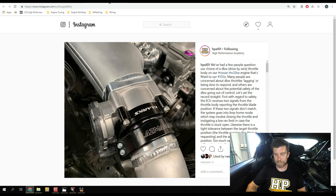If we head across to my laptop screen, this is an Instagram post I put up a few days ago. We did get a few comments on our Facebook page about this. We have gone to a Bosch Motorsport drive-by-wire throttle body on our SR20VE engine in the 350Z — the SR20 of this generation traditionally uses a cable throttle. Before I get into the reasons, when we talk about drive-by-wire throttle, we automatically get people asking about the downsides — thinking drive-by-wire is laggy and potentially unsafe. I just wanted to clear that up because it really isn't the case.